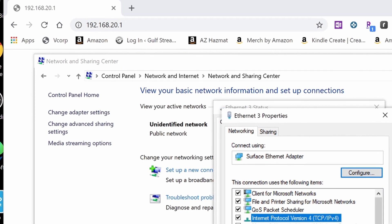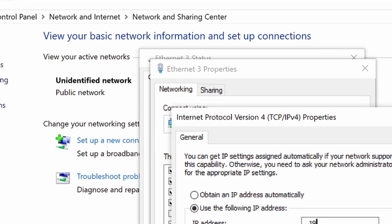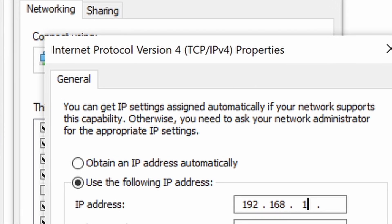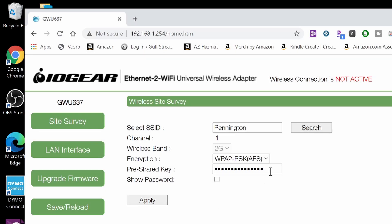With this, I should be able to take the Ethernet out of the Saturn, into this adapter, and to the Saturn it thinks it's plugged into Ethernet — to everything else it's Wi-Fi. I followed the instructions; there's a little bit more setup than you want to have — you've got to manually configure some IP addresses. The documentation is good in that you can understand it, you can follow it, you can see what to do. But then I started running into this problem where I would configure my Wi-Fi network, put in the password, hit submit, and it would just give me an error message.